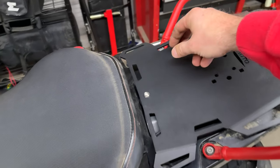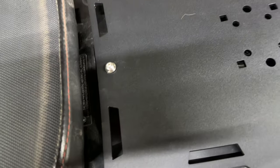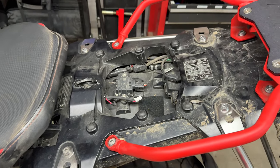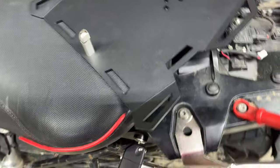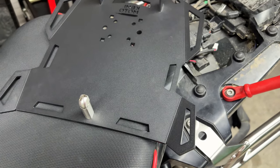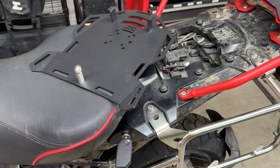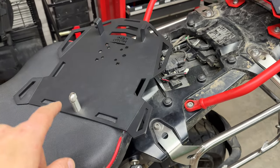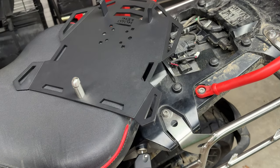It's even worse in the front position. Maybe I could tighten this down a little bit. No, that didn't work at all. So $25 versus $200. What I'm going to do is put some sound deadening, thicker foam material here that will keep it from rattling. Rattles drive me crazy — if there's a little rattle in a car I will tear the whole dashboard apart to get that sound out. So I'm going to stick some foam on there, and that should eliminate the problem.